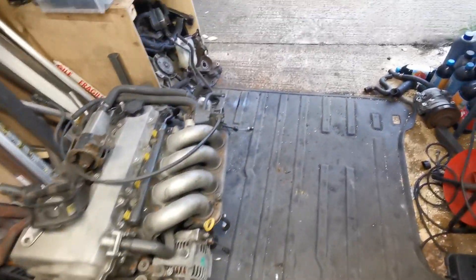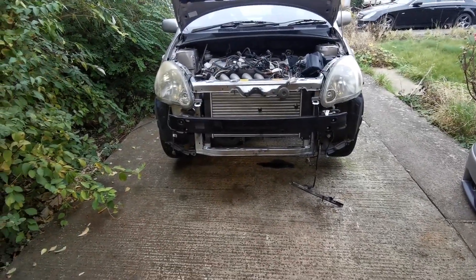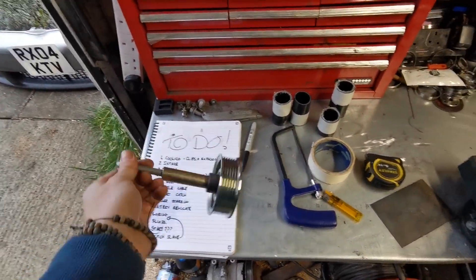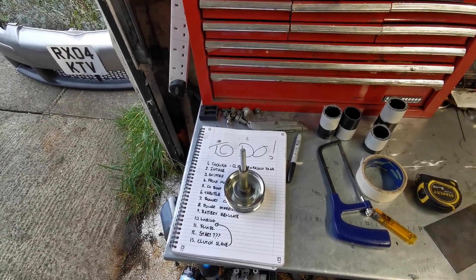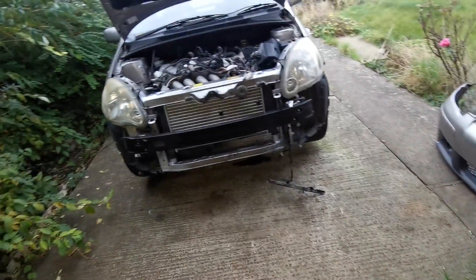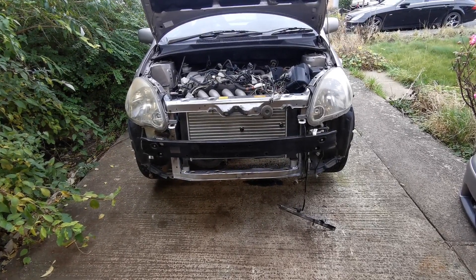Are they electric racks, the non-powered ones? Let me know. I'm going to loop the lines initially — after all that time bugging around last week sorting out the steel lines, I'm going to pull them off and just loop it. If you know, let me know, and if you're interested I can stick the part numbers for this in the description if you want to de-power your own Yaris 2ZZ rack. I'm just kind of praying that I don't need to take the engine out to get those bolts out because they might hit the chassis leg.